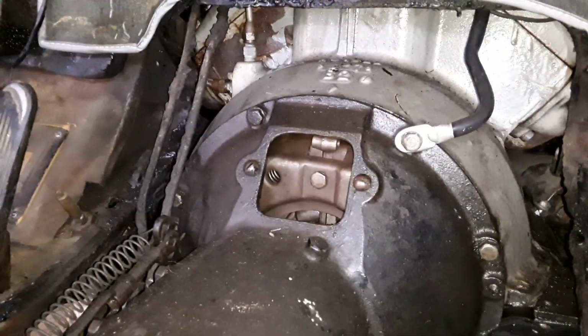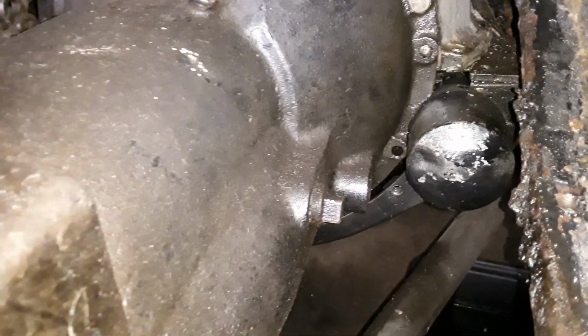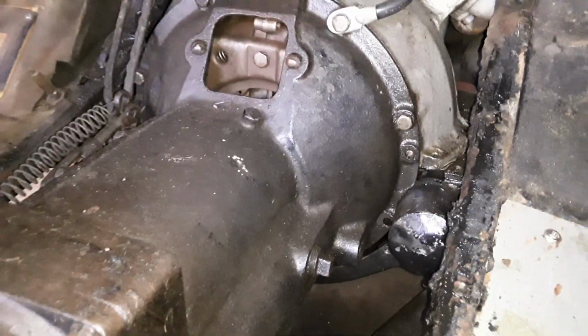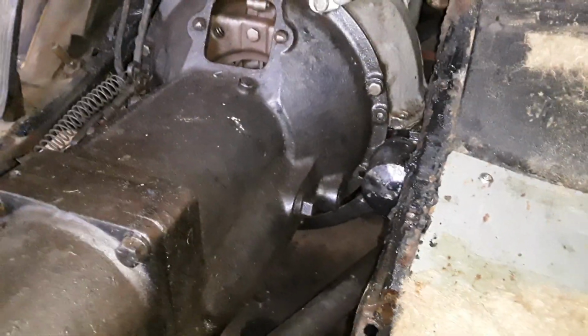Ford recalled them all or bought them all back, something of that nature, but you can see down here below you have 4 bolts holding the transmission to the back of the engine at the top, and the 4 that normally bolt into the lower cover portion of the oil pan do not line up. Can't quite see them all, but you can see there's an open space there. That oil pan is different between the Liquimatic and a regular manual trans. That was never changed. Whoever did this conversion only changed the transmission.